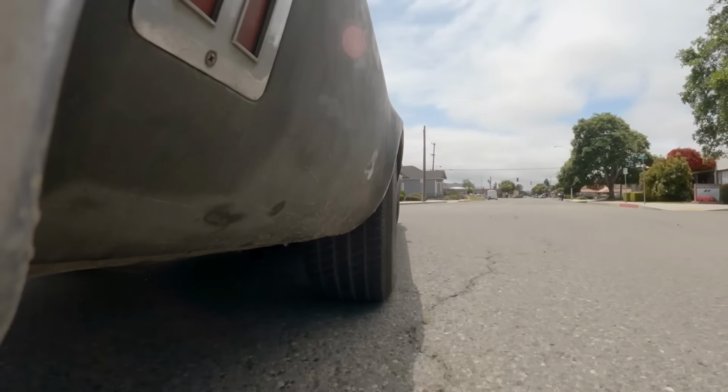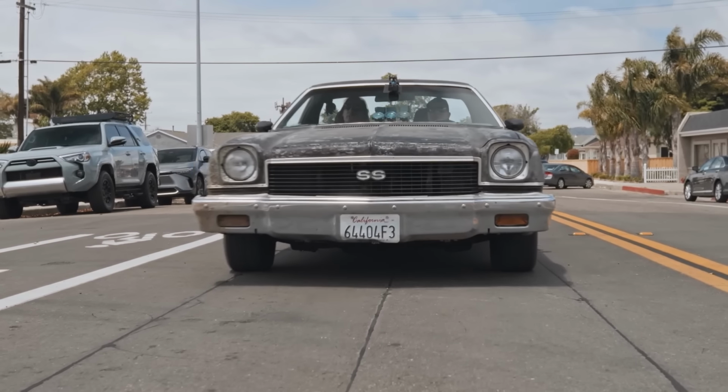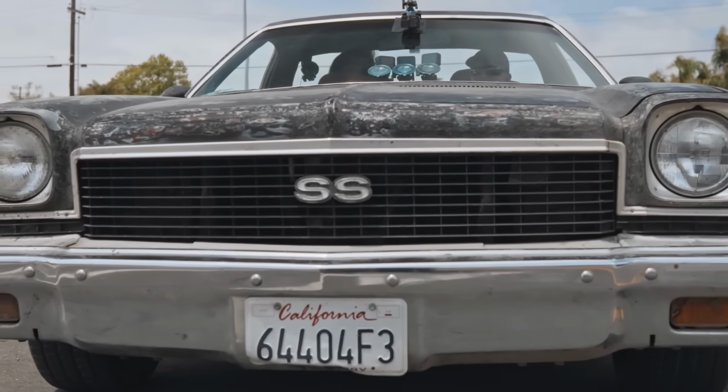Steve, here's the thing. People ask me all the time about these throttle body injection self-learning setups. Yeah. So I figure I don't have an expectation, and neither do you, that this is gonna perform better than the carburetor. Like, it's not gonna be faster or anything like that. Well, no, but the engine doesn't know anything but what its air-fuel ratio is. Right. And this has plenty of airflow, probably way more than the carburetor, because there's no boosters in the barrels. But as far as drivability, ease of starting, reliability, long-term storage, stuff like that. I mean, we put our carburetor up for 2 years, and we had to take it apart and fix it to get back on the road.